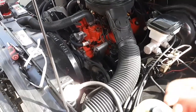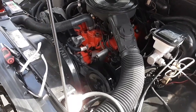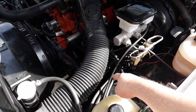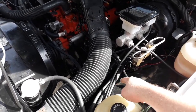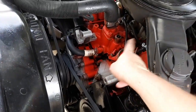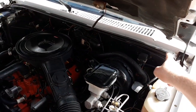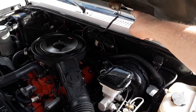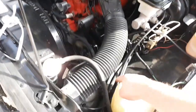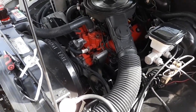Of course, the 4.3. I need the wiring harness, the transmission, because it's not the same as the 60 degree. It won't work. Bolt pattern is different. The fuel lines from it go from the main fuel rail down here. The earlier model 4.3s had them where they came out and came up here, and then up to the TBI. The later model style came up the fuel rail or frame, came off up the transmission and in the back of the motor to the throttle body. I can't use those because my fuel lines come up down here. So it has to be the earlier model 4.3, which is hard to find.